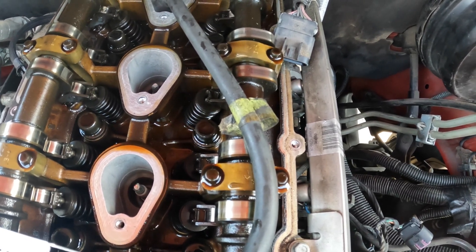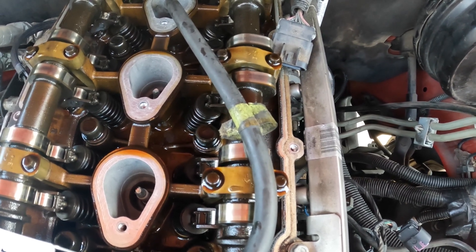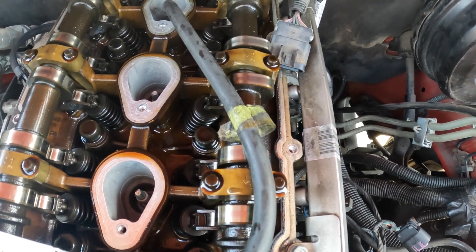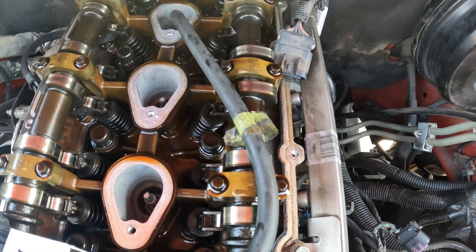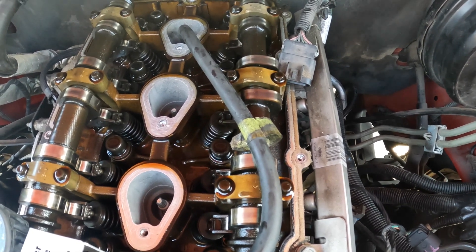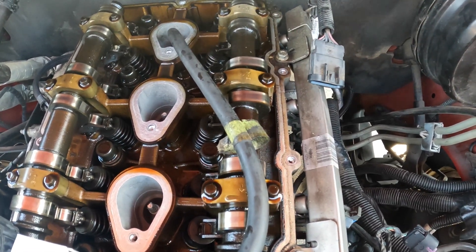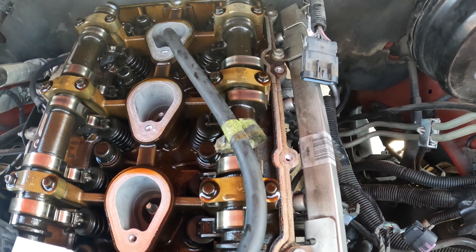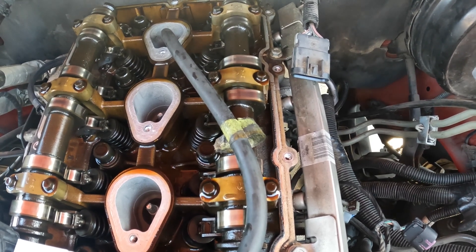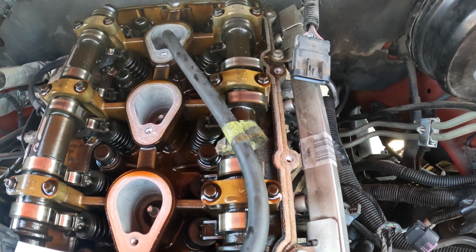Well, we're at this point — he wanted me to see if I saw anything with the valve cover off, and I don't see anything. So I guess we'll just see what he wants to do next. Not really a lot in this video, but I did diagnose that it's coming out of the intake valve, and now we're going to see what the customer wants to do — see if he wants to proceed with a cylinder head. If y'all found this video helpful please hit the like, subscribe, and notification bell.